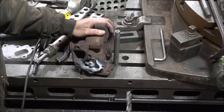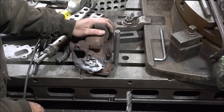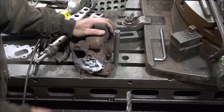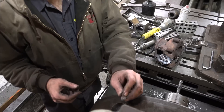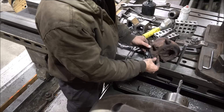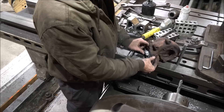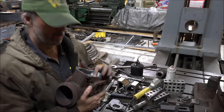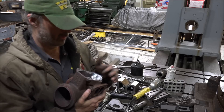I think this is a worthwhile improvement to do on one of these turbos, particularly in a twin setup where you can route more gas past the small turbine into the big turbine where it can be more efficiently used to make boost. I'll get this little arm welded back on there, clock it so that it can get full travel without hitting this ear here.